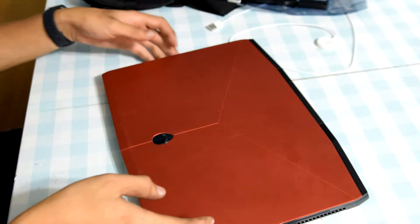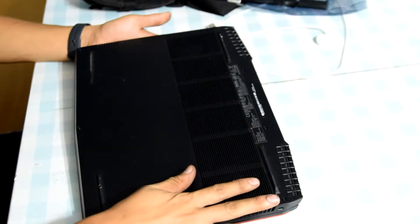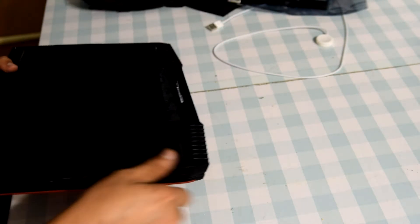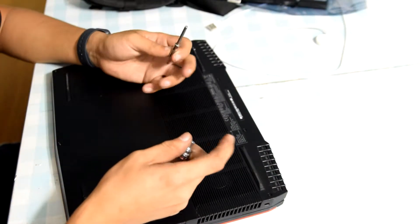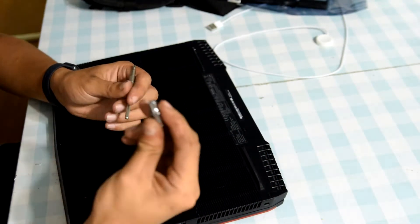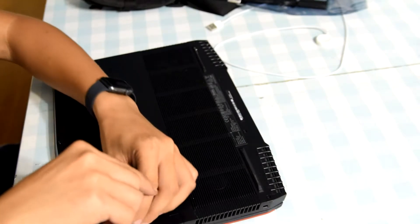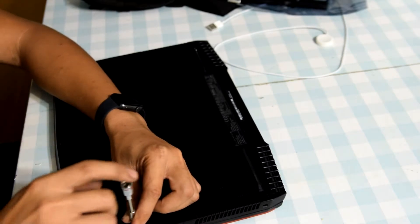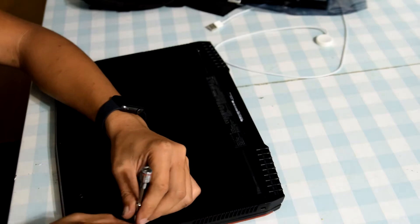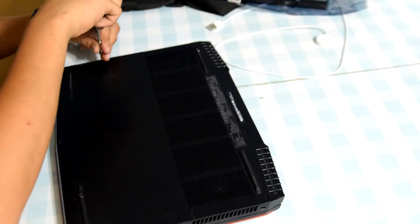The good thing is the batteries in these are really easy to replace. First things first, make sure you turn your computer off. You'll be removing some screws on the back — there are nine on the bottom and two on the top, one here and one here. For this you just need a small Phillips screwdriver. Harbor Freight sells a nice precision screwdriver set cheap. I'm using a socket for a bit more leverage — not ideal but it works. Put pressure on the top before turning to minimize cross-threading, and place screws somewhere you won't lose them. These are all the same size.